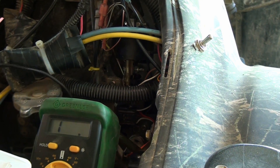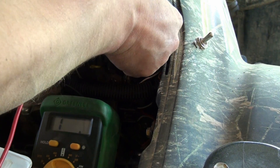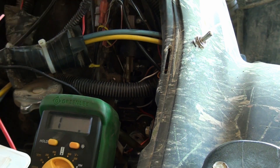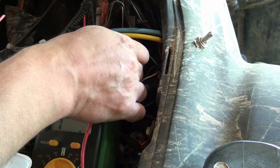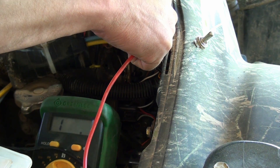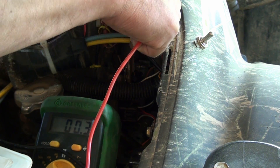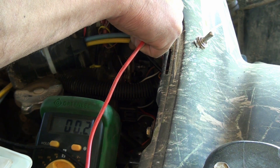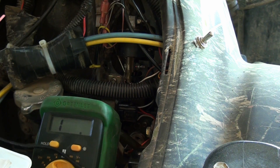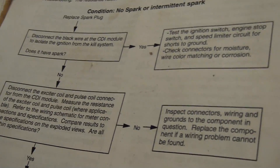I'm going to take the top bolt here and try to clip it on, then press it tightly against the mounting bolt. I'll come over to a clean spot on the engine. I'm at 0.3 — it's supposed to be 0 to 0.2. There's 0.2 right there. So it looks like we're good. We do have a good ground on our coil, which basically eliminates the possibility of a bad ground.